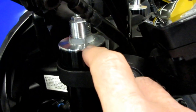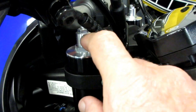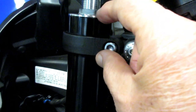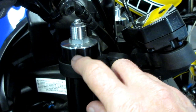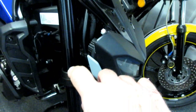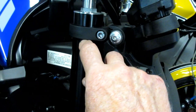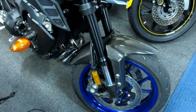On the MT-09 when I originally did this — and I want to thank Bob who gave me this idea, he had lowered his Honda 900 with good results — I went all the way. There's machining on the forks themselves that tells you where Yamaha thinks the maximum amount you can lower is. If you're new to this, maybe only go half of that amount. Look for the diameter change as you go up — it has like a Coke bottle shape — and I assume that's what they're telling you: don't lower it more than that, or you might potentially have an interference fit.